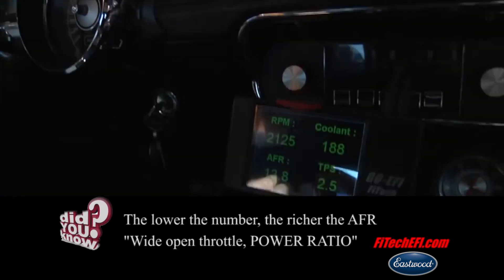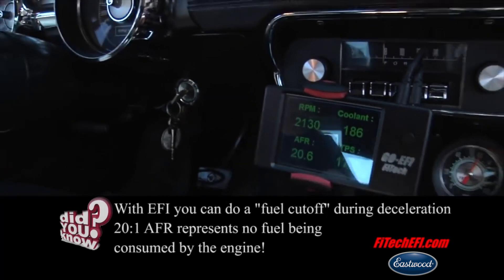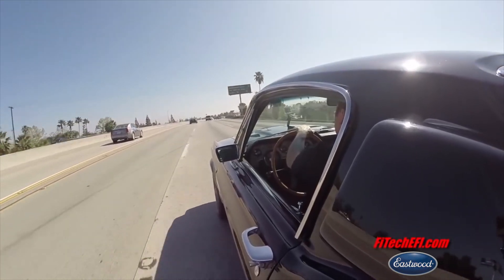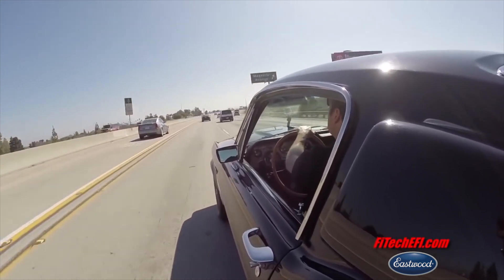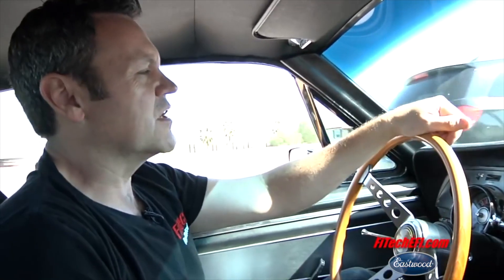Here's the nice part about saving fuel. When you decel — if I let off the throttle and kick down — we're using no gas right now, and then I run back into it and we jump right back up. So whenever you let off the throttle and decel, your fuel cuts off. You're saving gas just like a new car. It doesn't seem to add up, but on a long trip that makes a big difference. With a carburetor, that just doesn't happen — you're using gas whether you're on the throttle or off the throttle. That's how a fuel-injected car makes that little difference and gets the gas mileage way up there. We add all of those features in with our EFI systems.